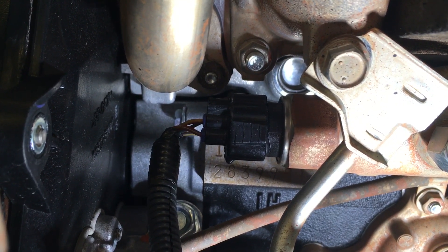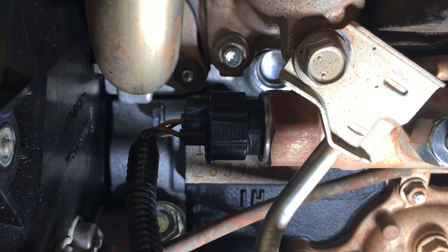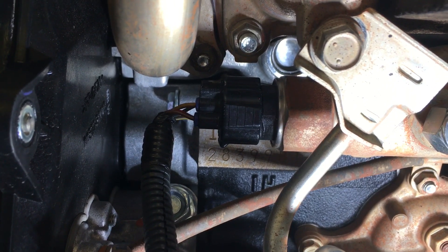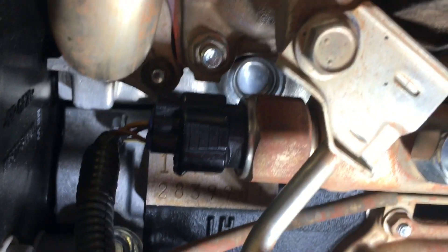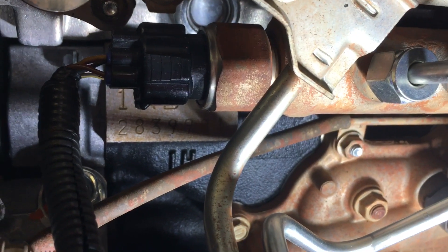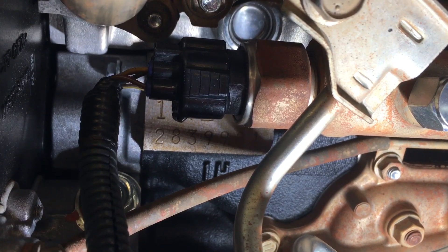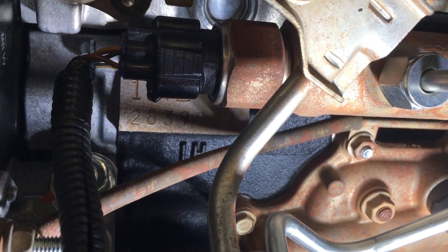You need to make sure you've got that clip released without pushing too hard because you could possibly break them. There's more information when you buy the injector kit in the VIP group, but we try to put a lot of free information on the YouTube channel. The best way is to press that tab, hold the plug, and give it a gentle wiggle with light pulling pressure backwards. Eventually you'll start to see a clean line just behind the plug — a millimeter or two of dirt — showing it's beginning to move.